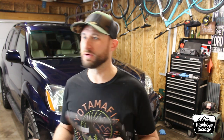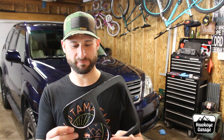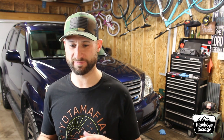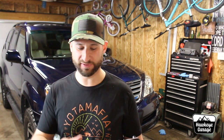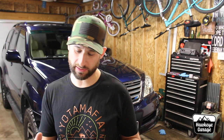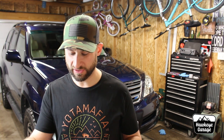Because I didn't really know where the cup holders were going to end up in this real estate, I originally just went ahead and cut all of that material out. There's the fake wood grain, then a real thin layer of aluminum, and then plastic. Since I didn't know where I was going to end up putting the cup holders, I just went in there with my cutoff wheel, cut it all out, and then I used some JB Weld plastic weld — a two-part adhesive. I cut a piece of ABS plastic and put it in there.